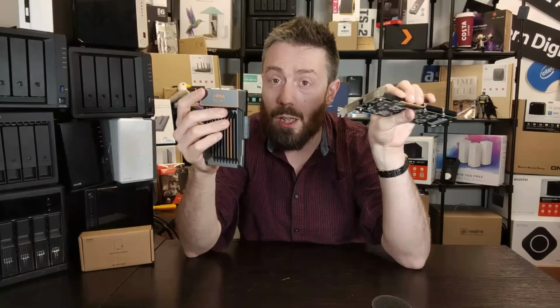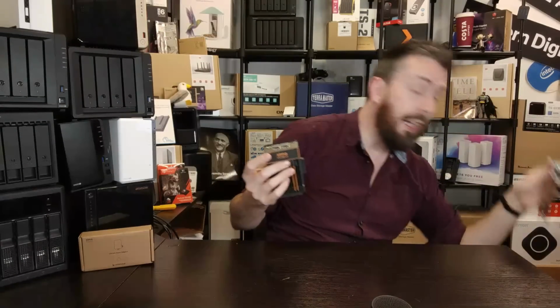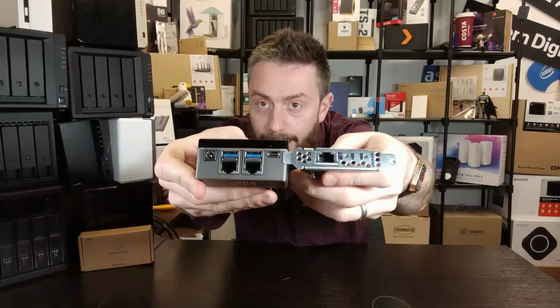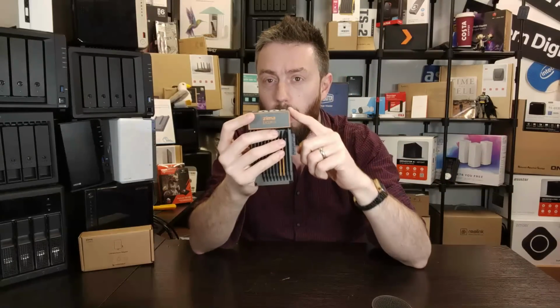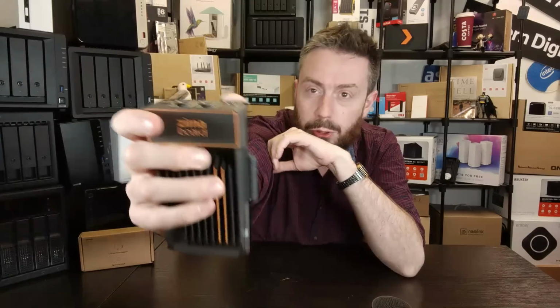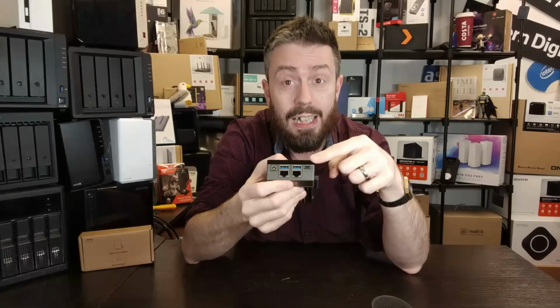And it means if you're going to use a card, you're going to have to go for a card that has a hugely limited backplane, much like this card we'll talk about later on. If we get that card inside there, even then it's got that plate over the top. So you're going to have to get really, really small, enclosured, covered backplane PCIe cards because of the protrusion. And of course, they're trying to maximize as much space as possible. They've needed that space for that.